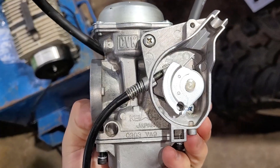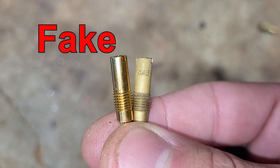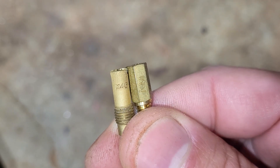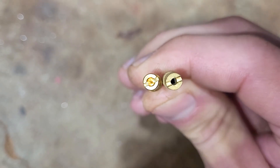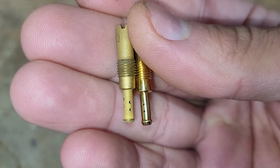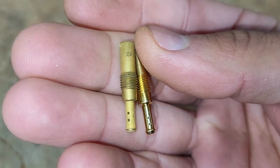Here are some carburetor examples of what these jets go in. Here are the pilot jets. You can see the fake one next to the real one — you can see the difference. The genuine ones have that little star on there; it's really a K shaped like a star. That's how you know they're genuine Keihin jets. Here's the top of the jet — you can see the machining difference. The hole sizes are different, totally different size and different placement. They're not even set up the same.